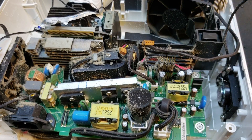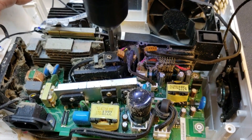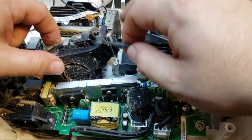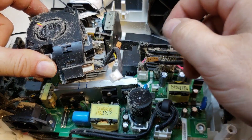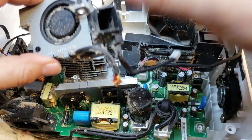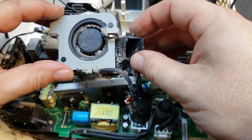Then the important fan — the fan that keeps the lamps alive — is this one right here. This fan has the issue of keeping the lamp cool. There is a temperature fuse mounted to it right here. If that gets too hot, it'll pop that resettable fuse and shut the whole projector down — just kills the power to it. Looks like it wasn't far off from doing that. That fan is just totally clogged. Still rotates, so the RPM sensor won't trip it, but man, that's bad.